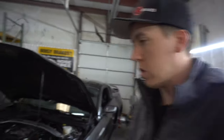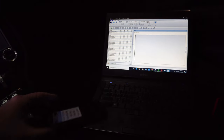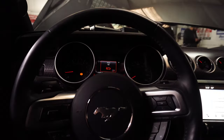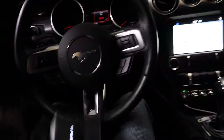That is how you can dyno an S550 Mustang — as far as I know, this one's an '18; I'm not sure about other years. Now we have all the PIDs set up from Lund for their data logging through the BDX, goes over the computer, ties in. You got this little handheld that you use with the software to download. We're gonna let the car warm up all the way, and then since we're on a dyno they really just need some full throttle pulls from 3,000 to 7,000 RPM. Let the car warm up, do a little log, let it sit at idle for a few seconds, then roll into the dyno pull and send them a couple of them.